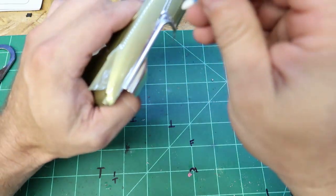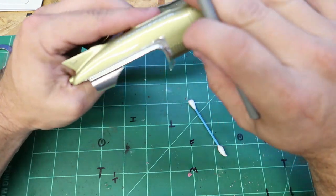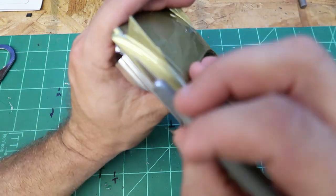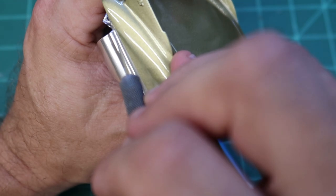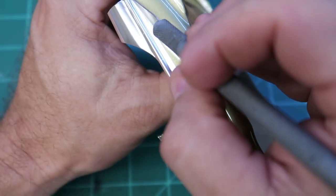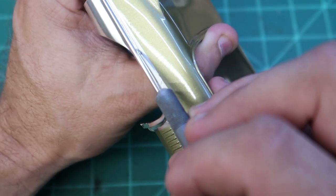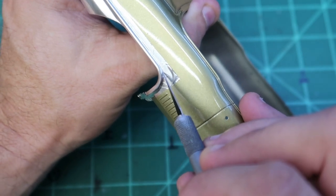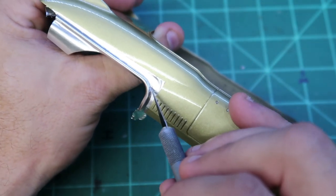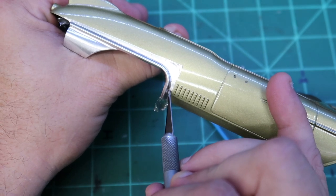Okay, so I want to now focus on getting the foil around this trim off. You'll simply take your knife, find the best starting place for you, and lay that knife right in that trough or body line, and it generally will follow. I do sometimes paint my blades black. It helps you to be able to see a distinguishing color when you're doing this, but just gently let your knife ride right down that body line. And when you get to a corner, I try to never take my knife up. Just continue to let it follow that body line. And it sometimes will get away from you. It happens. Just like that.